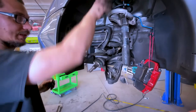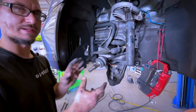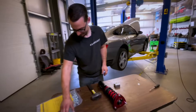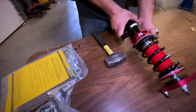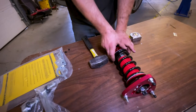So we'll lower it, get the top off, put the new strut in, and I'll show you the preload adjustments for that. Let's go get the new one. They always come with tools — the little spline wrenches — and these are the allen wrenches to set the coils, because this one doesn't have a secondary collar. It has an allen that tightens and snugs it up.